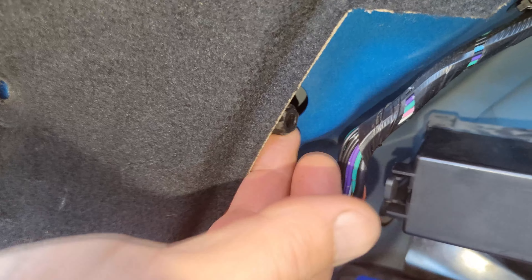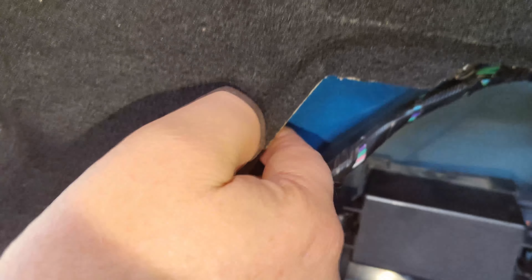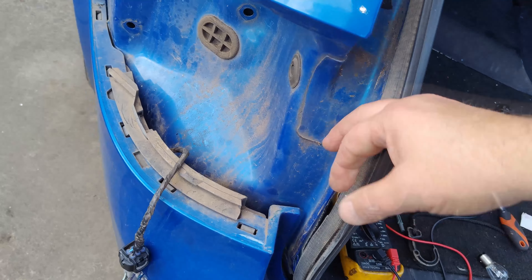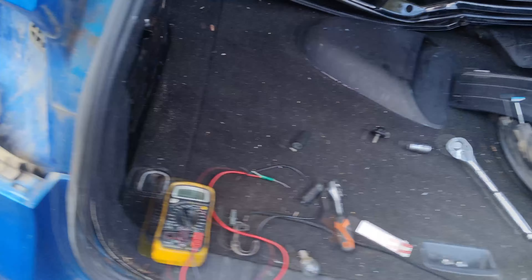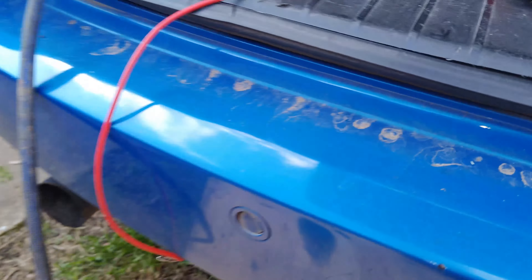To get the taillight out, you've got these little wheel things here that you turn to get it loose. There's supposed to be three of them but this one only has two — there's supposed to be one up there, there, and down there. I'll undo them and pop this light out. You need to remove this rubber a little bit because it's stopping the black trim, like on this side here. I'm taking this side out so I can find out what colour wire I'm working with for the taillight.